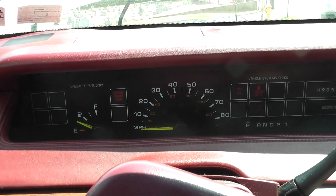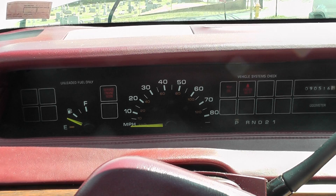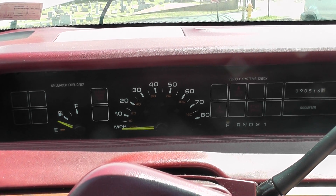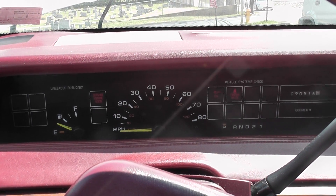I do have a check engine light that's lit. Now if I had a tachometer on the dash, I would look for the tach to bounce or move during the crank. So I'm going to crank it — and it's a crank and a no start. Got to go under the hood now and check for spark, which is the next easiest thing.